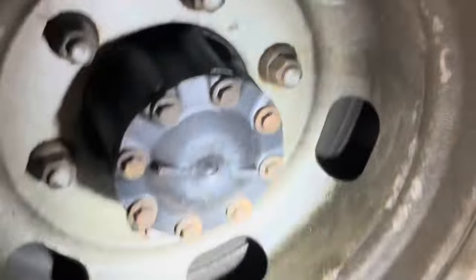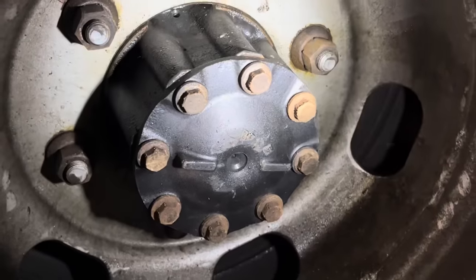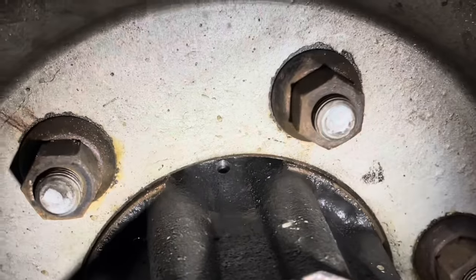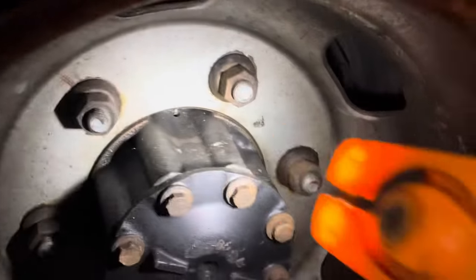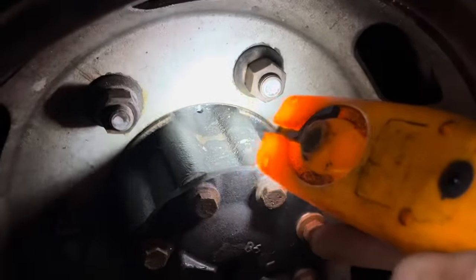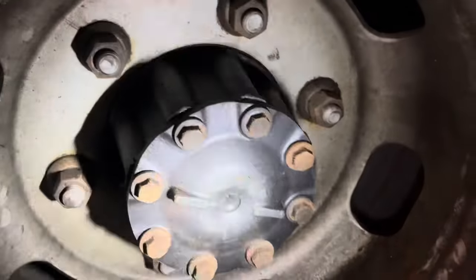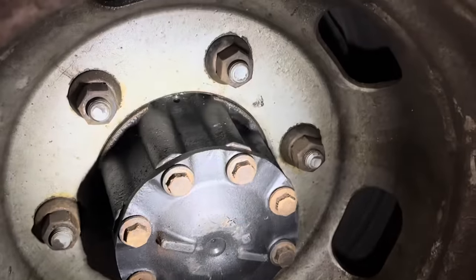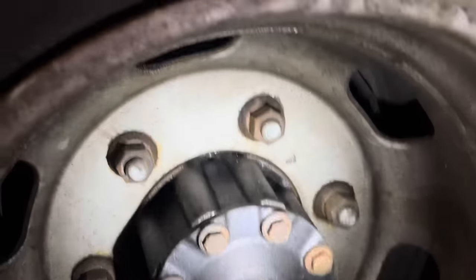It's leaking on the wheel. I'm hoping it's a half shaft. Let me get my torch on the job. It is leaking there. By the looks of that it's not the half shaft - it's coming out that hole there, which means it's the inner hub seal, because that's what them holes are designed to do. So I've got to have this apart then and see what the crack is.